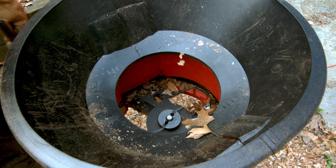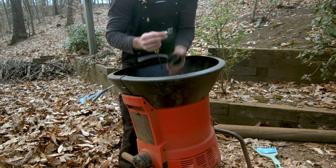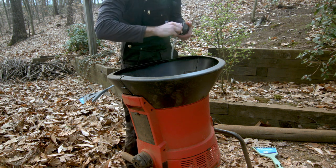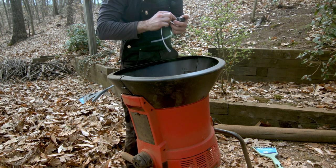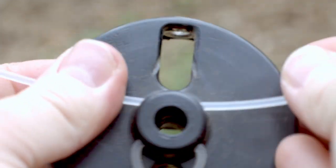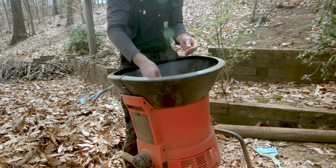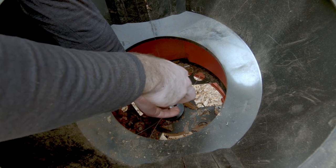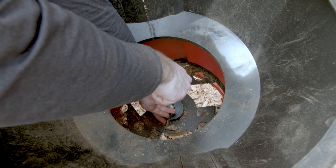The most common issue I've noticed is that a lodged twig will sever the cutting lines, which means you'll need to turn off the machine and replace the string. Thankfully, replacing the string on the Flowtron is way easier than on a weed whacker. You need a flathead screwdriver to take out the plastic assembly holding the cutting lines, then you slip the new cutting lines in through the holes and place the assembly back inside the hopper. If you do a good job plucking twigs out of the leaves as you go, you won't have to change the string too often. I found I was replacing the string about every 50 minutes of continuous use, with the string replacement taking around 30 seconds at a time. Several people recommend buying a roll of weed whacker string instead of the more expensive cutting lines from Flowtron.